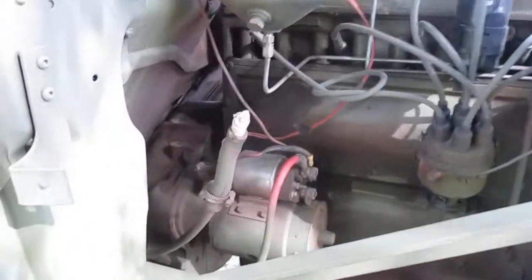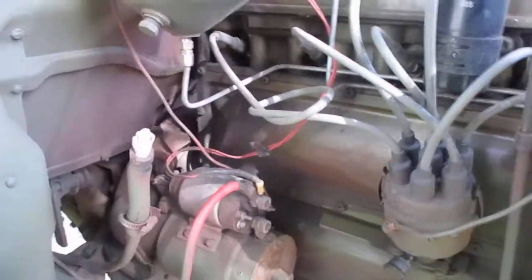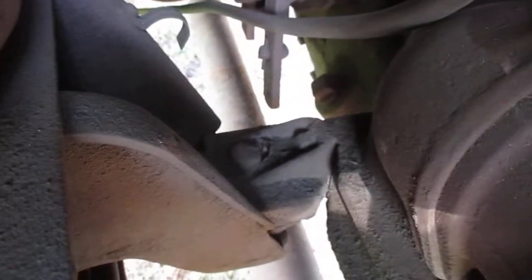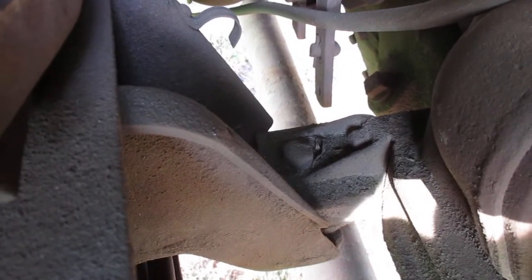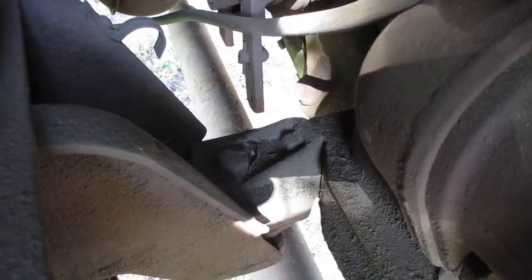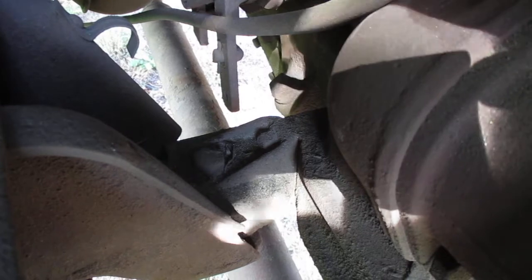What's required to install this engine is a different engine mount. Up front here we see the starter — I'm still working on the truck. Back here is the transmission mount from the bell housing to the transmission mount to the frame. We start with a hard point here because we know everything is fixed at this area, and we don't want to adjust the transmission mounts.